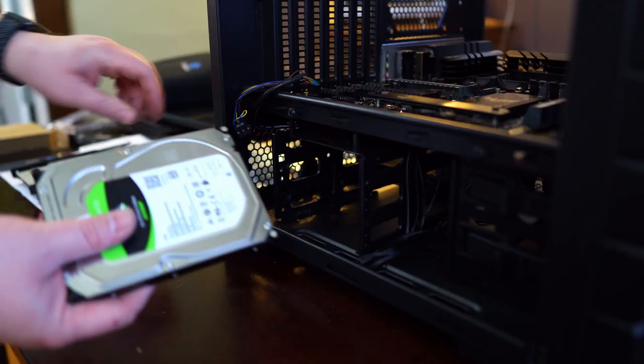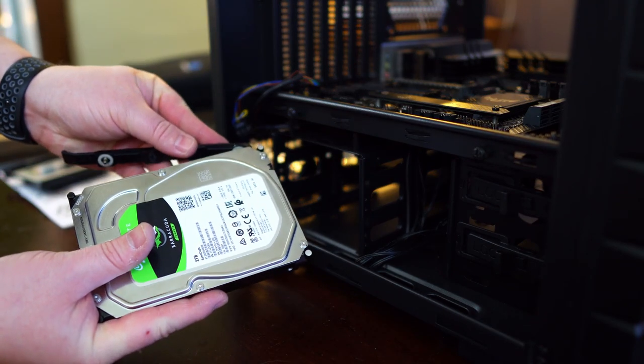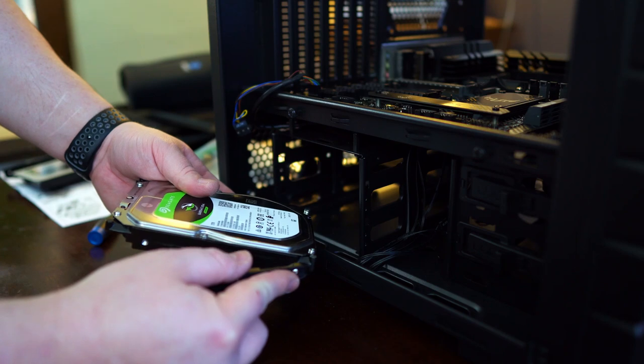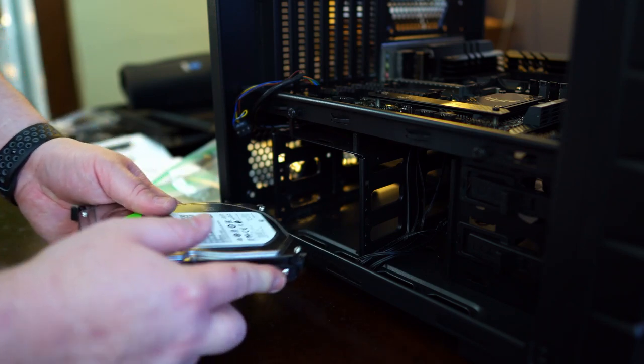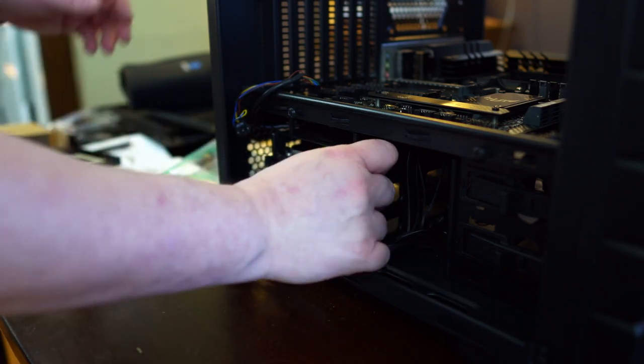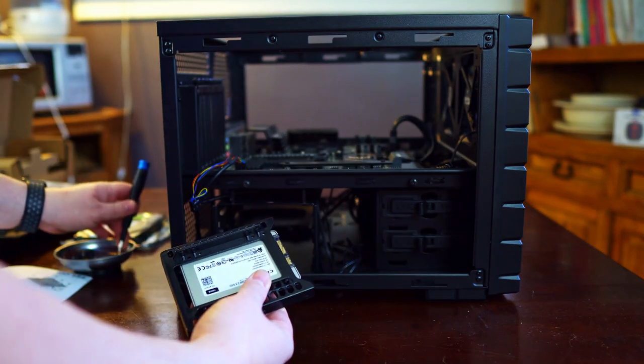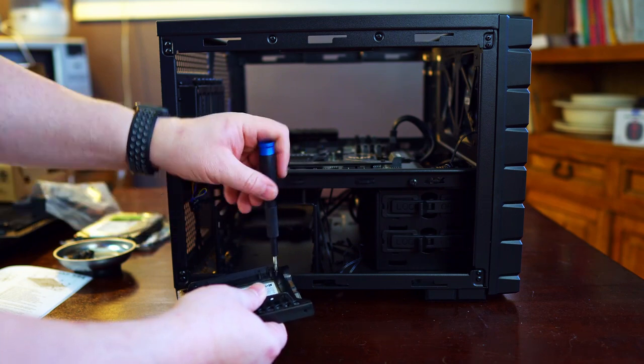In addition to the hot swap bays at the front, which I already talked about, there's another cage for two more hard drives, either 3.5-inch or 2.5-inch, at the side of the case. This makes for a total of four hard drives you can install. You can access the cage by taking off the right side panel as you face the back of the case. Installation is toolless for 3.5-inch hard drives, but not 2.5-inch drives.